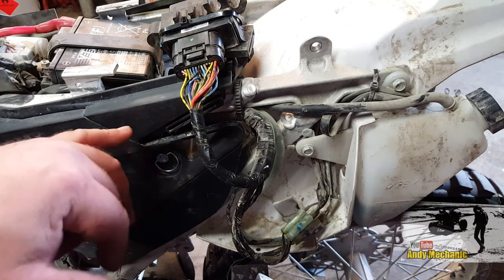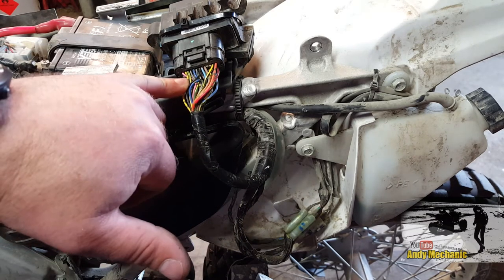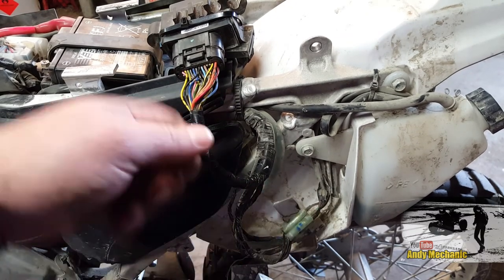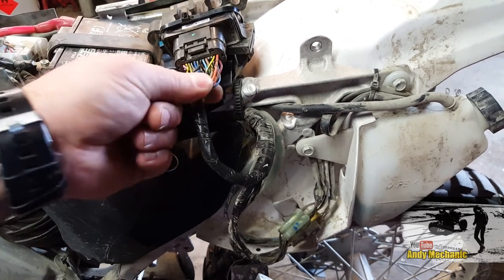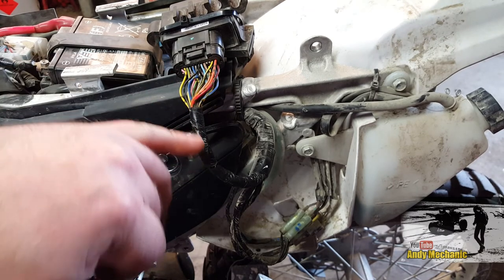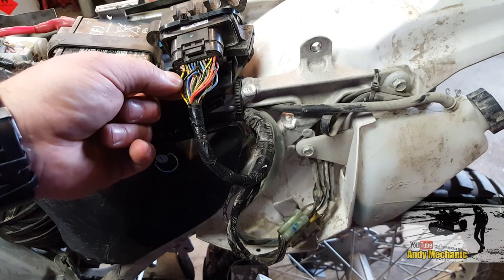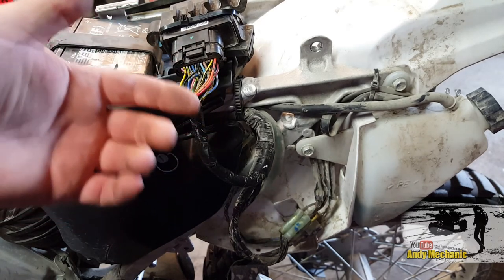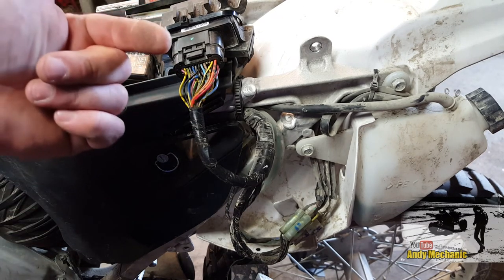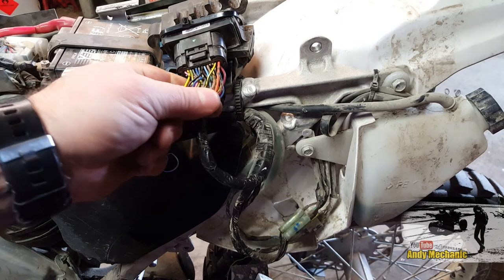The easiest way to capture waveforms if you're going to be testing a number of sensors - say you're looking for a fault - is to go at the ECU end. The ECU is normally located down here; I've just pulled it off its mount and zip tied it up onto the frame so I've got good access to all the wires from the sensors going into that ECU. The other benefit of checking the sensor signal at the ECU end is it also checks the integrity of the wiring. So if you've got a bad signal, you know it's either the sensor or the wiring. If you test at the sensor, you may overlook a wiring problem. If you see what the ECU sees and it's good, everybody's happy.